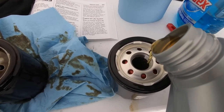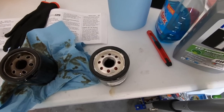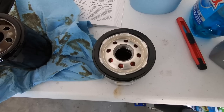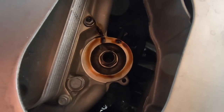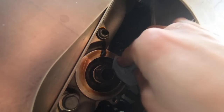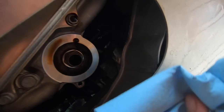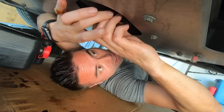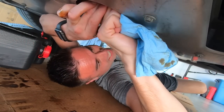I was also always taught to prime your filter, so go ahead and fill it up about halfway — that way the motor isn't trying to prime it while also getting oil to the rest of the engine on startup. In case anybody's wondering what it looks like up in there without the filter, this is where your oil filter attaches. Go ahead and clean up any excess oil from that area so we can take a quick look later and see if it's leaking.